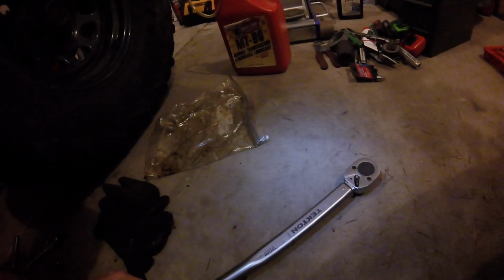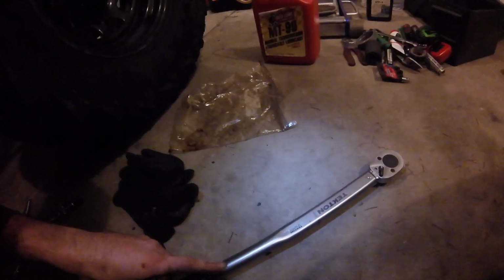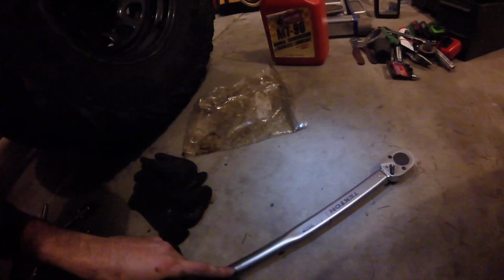And reinstalling the transmission drain plugs, if you want to get really technical and use a torque wrench, they're 22 foot-pounds. Here's the setup I have where I'm pumping the fluid in. So you can see it's this pretty easy bottle pump you can buy for probably like $2 at AutoZone.